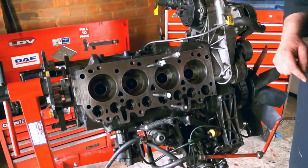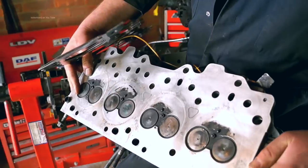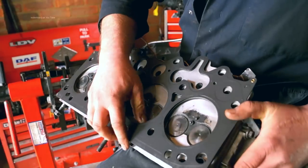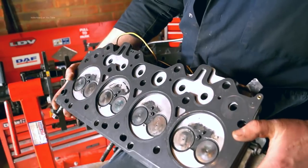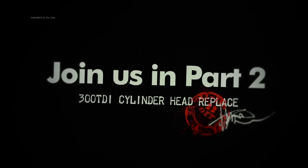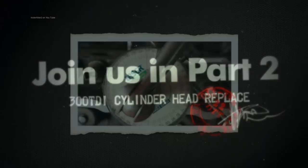The disadvantage I have here is that the block is on its side — you won't have this; I'm only doing it for video purposes. I have the cylinder head here and there's my oil hole. I have the dowel pegs in the head, which you should have in the block — this is only to help me locate so I can fit the head on in the way the engine is positioned. Okay, that's it for part one. Join us in part two when we use the right sequences to bolt down the cylinder head.